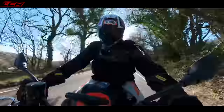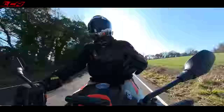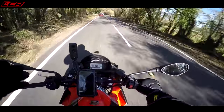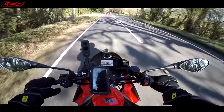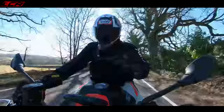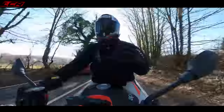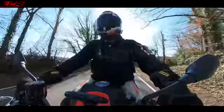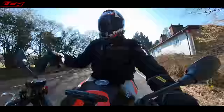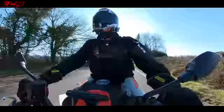With so little weight over the front by bringing that front wheel in, it also makes it very sharp. Of course what that can bring is a bit of instability on faster corners. And it's got no steering damper. So whether on higher speed corners if you hit bumps or potholes, that could unsettle the bike — that would be the only downside with bringing that front wheel in. But we'll see, we've got some faster bends up here.